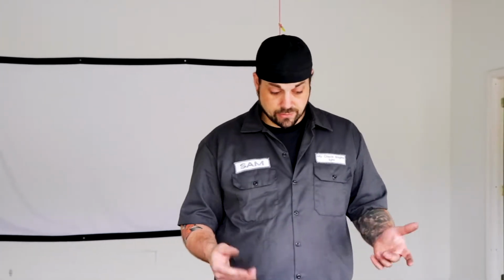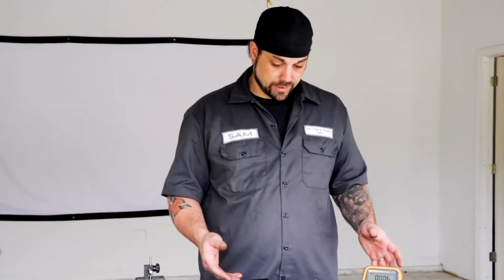So that's what I'm trying to illustrate here, is that this single strand wire doesn't really have any effect. If you have too much resistance by a lot, then it's not gonna work. Like, you might be able to make a portion of the circuit work correctly, but it's not gonna work with 75 ohms. But with 0.4, it works just fine, 0.4, 0.3, whatever. With 0.6, 7, 8, 9, like that, because earlier when I did this, it was actually reading at 0.9. I assume that it's probably temperature related that changed the resistance that we're seeing now.